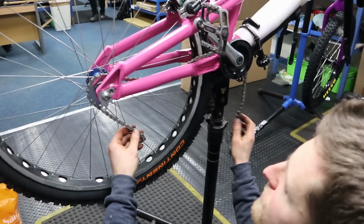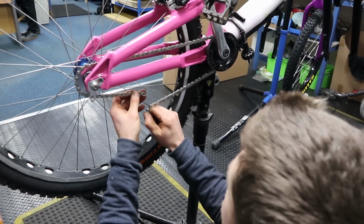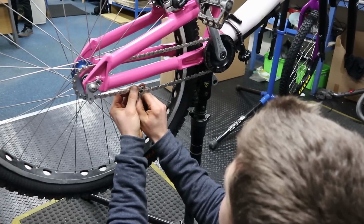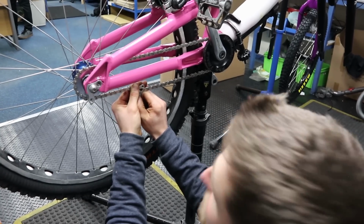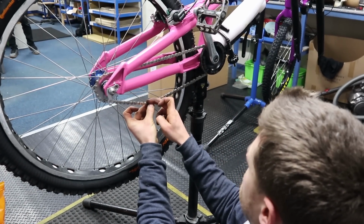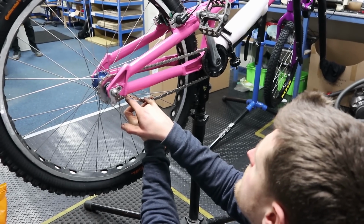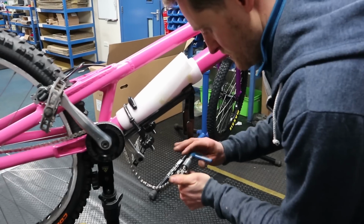Like I said before, with the slightly odd chainstay length compared to modern bikes and then an odd gear ratio, it's fallen exactly in between links. You could maybe get away with a half link, but it's a bit scary. So we're gonna have to join the chain here. So with a single wheel tensioner, you'd be sitting it down quite low, so you might be better off with a double wheel. Yep. To get the chain up there nice and high. Makes sense. Go with that. Yeah. Cool. Let's do that.